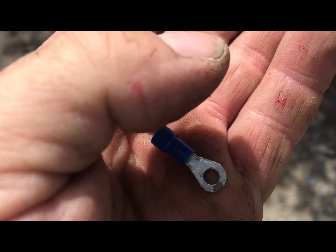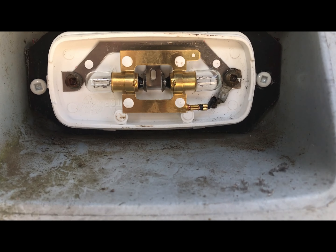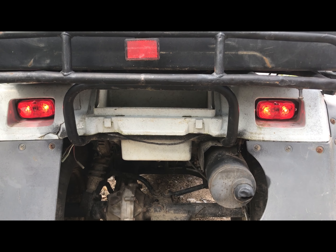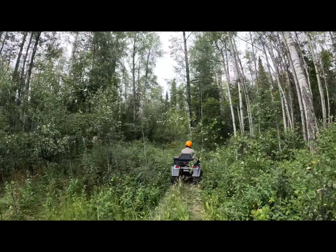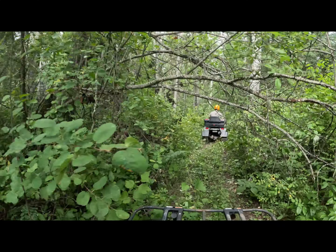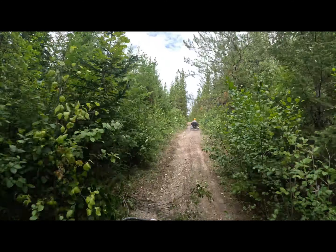Once you have that crimped onto your wire, take the plastic piece off — it'll give you more flexibility with the wire. So there it is mounted in place. I just have to pop the lens cap on and wire it and do the other side. There we go — some tail lights. All done. We'll see you soon.